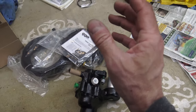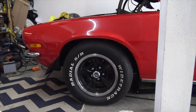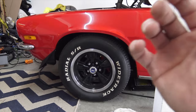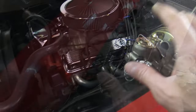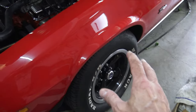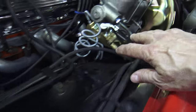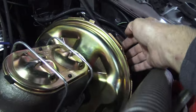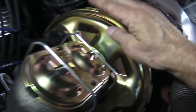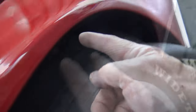In this video I'm going to install this on my 1973 Camaro, take you through it, show you how it works, and hopefully it'll solve all my braking problems. The first step is to take everything apart. I found that removing the front wheel and the inner fender allows easy access to the whole brake area, especially the bolts — they're buried back here. There are four bolts that hold the booster on; you just unbolt it from inside and it'll come out.